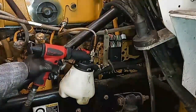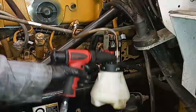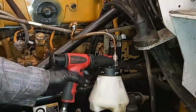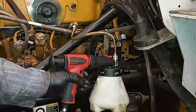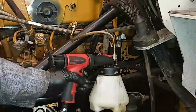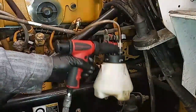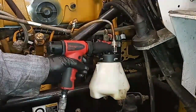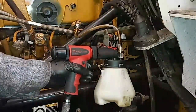By pulling a vacuum and removing all the air out of the system, you are going to be forcing the fuel from the tank at about 13 to 14 psi through the filters, through the cylinder head, and into our little vacuum system. There's no negative vacuum — you're actually just removing the air, and then atmospheric pressure around us is pushing down on the fuel in the tank and forcing it through the system.